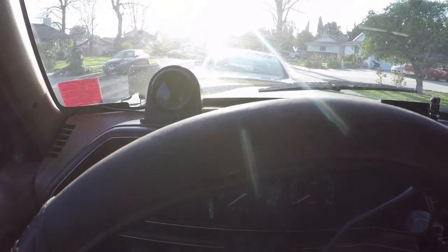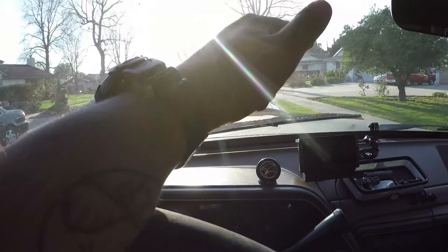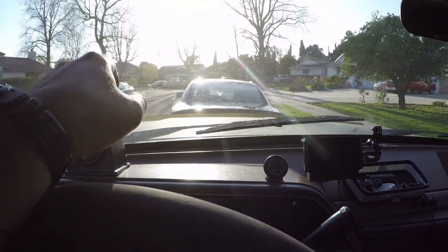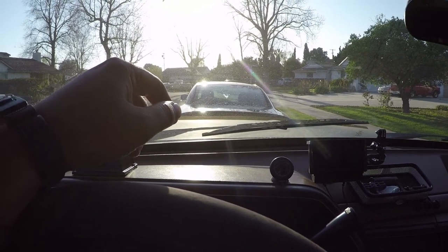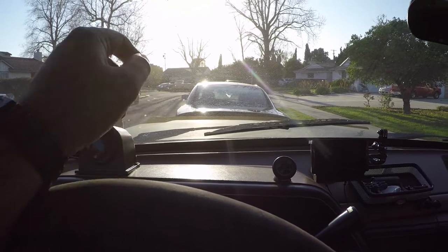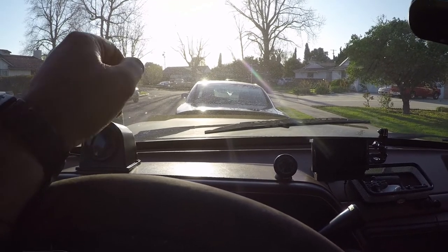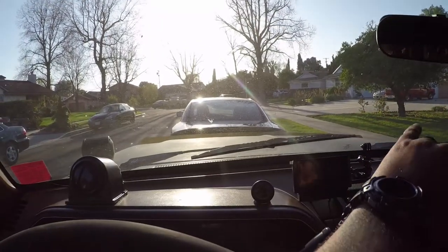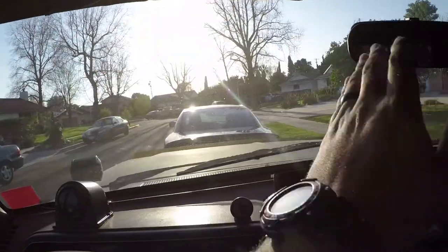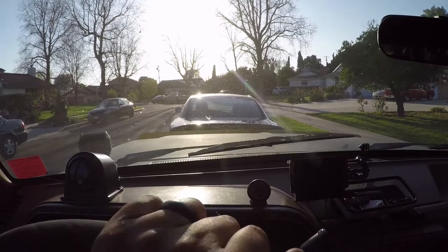And yeah, that's the only wire that I've brought in here. It's pretty easy. The green wire ran straight to the sensor, and the black wire I grounded to the fender. I gotta move that one because I just ran out of wire, so I gotta eventually wire it so I can ground it to the battery. I need about 3 more feet to run it neatly.